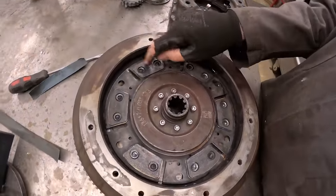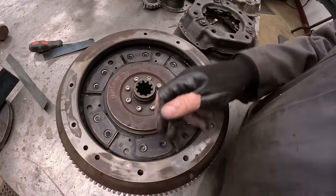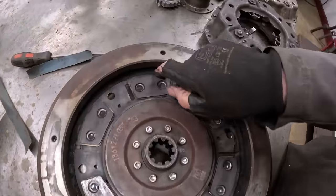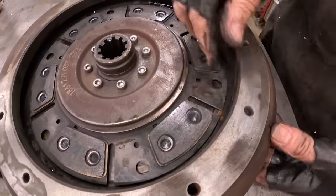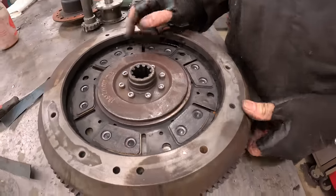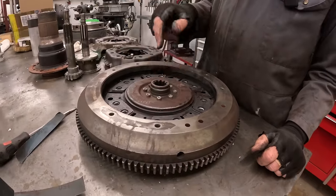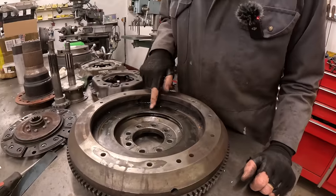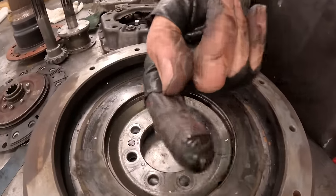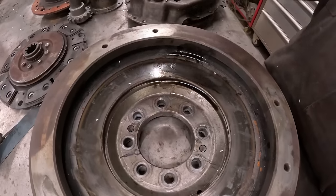But you can see all the work's been done that side, and it's just been slipping the other side. It's got this groove for the oil to go in, but it hasn't got any holes going to the outside. So that fills up with a little drop of oil. It ain't got anywhere to go. But I don't know what to think, really, because it's not a lot of oil. But that's enough to make the clutch slip. So anyway, we're going to do that.